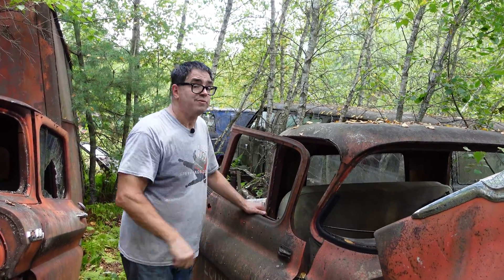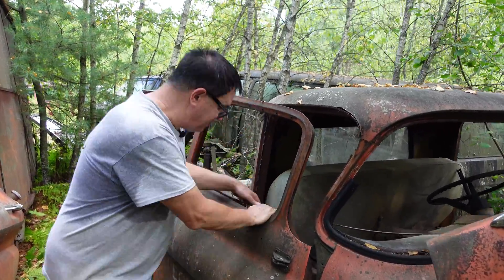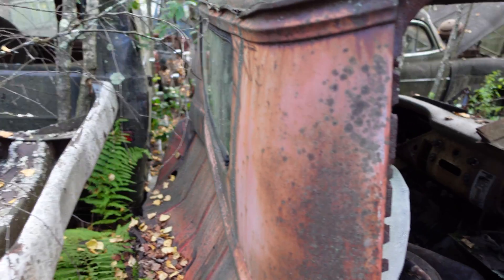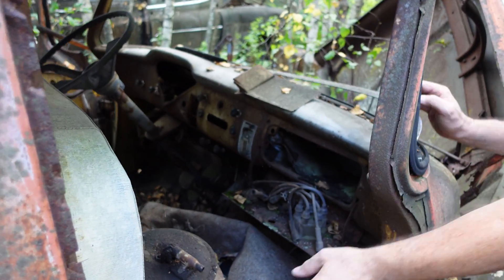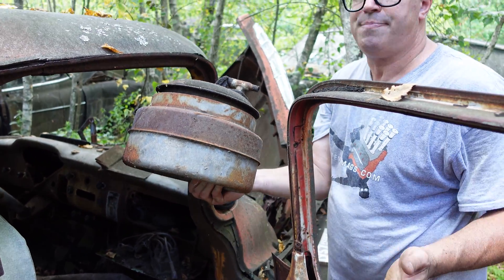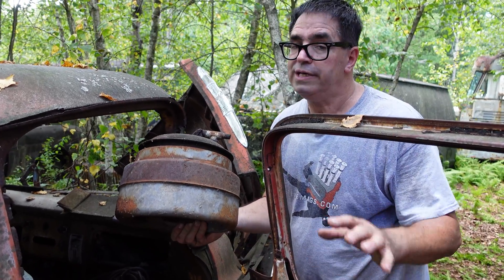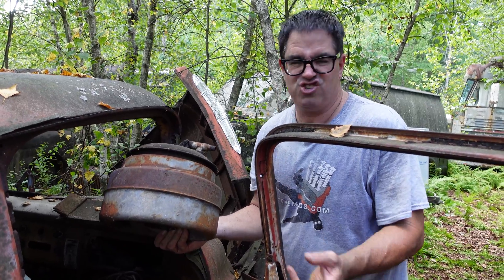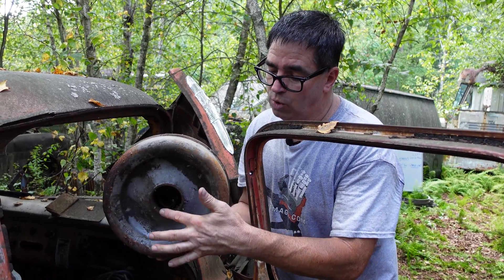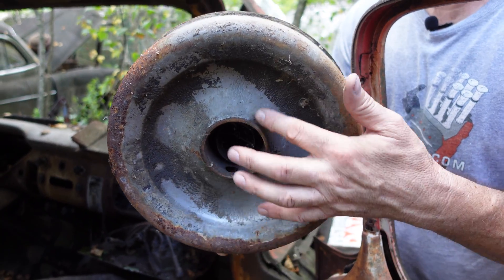This could have had a 348 — the W motor, the big block — introduced in 1958 as the first big block. But on this one we see the original air filter. We'll trade places here, and opening the door, here's the air cleaner. This one is an oil bath type — heavy duty — and unlike a paper element, these do a better job for a longer time of keeping the air clean in a really dirty environment, like a sand pit or a city with grit. This one has a very small hole, so this was definitely on top of a two-barrel carburetor, which tells us probably the 283 small block two-barrel.